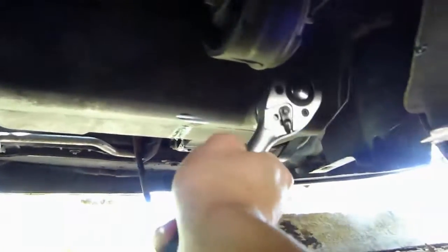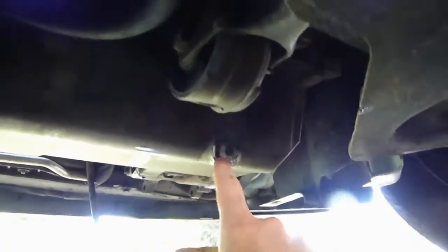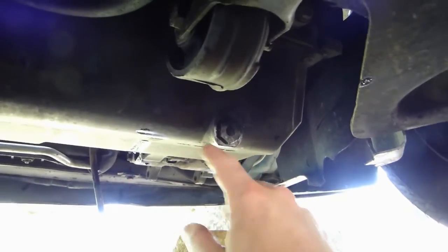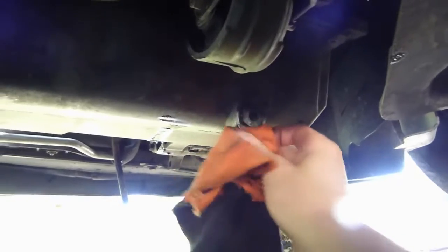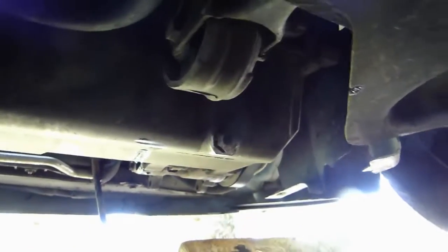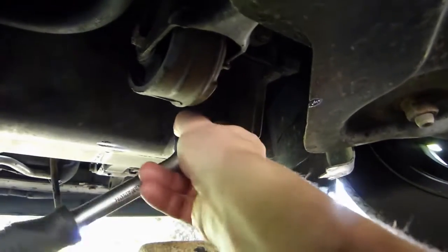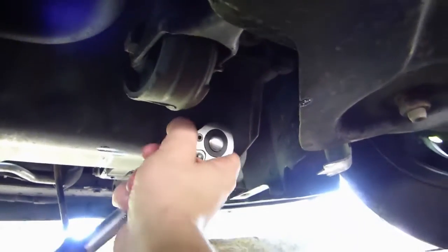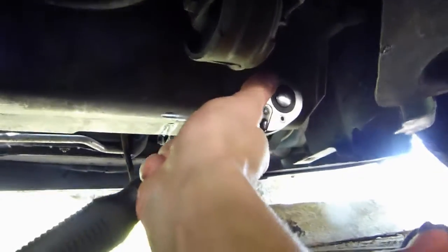And anyways, once we've put the new oil in, we're gonna come and check here. Once we've got the engine running, check here if it doesn't seep through. And if it's not the case, then that means you've tightened enough. Otherwise, just take your key again and just give it a little more. I think for now it's good.